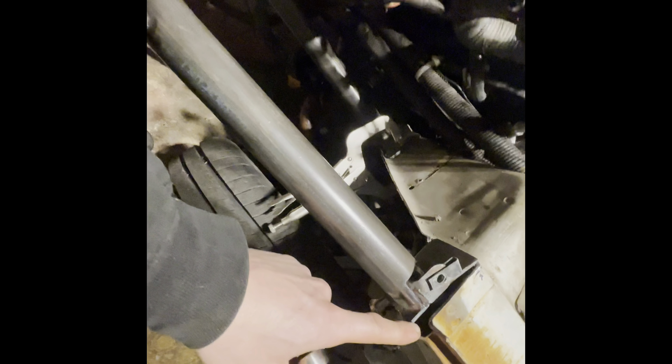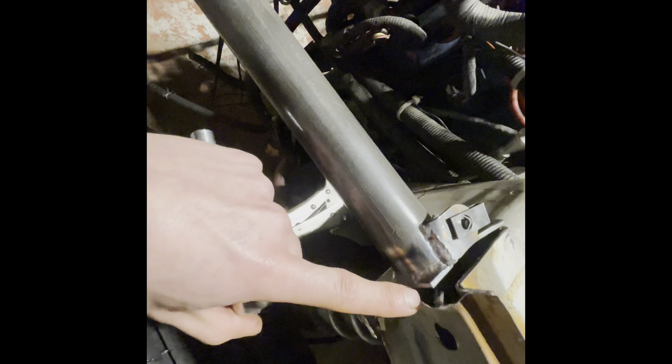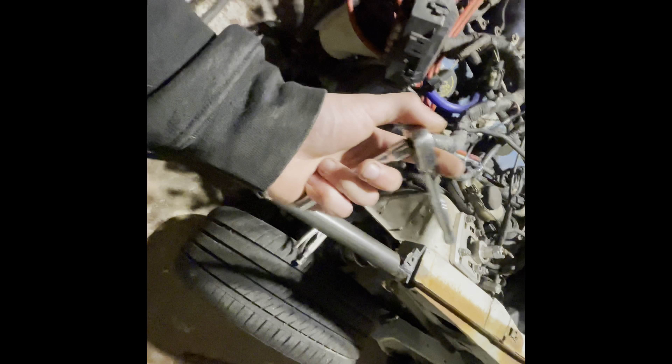But if we come over to this side, this is where stuff gets a little bit hairy. As you can see, we have a pretty significant gap right here — it is pretty bad. Remember, this is the crash side, so this is all tweaked and everything. What I'm going to do when I go to fit this back up is tap this in, tap that down, tap this back — whatever I've got to do to close this gap the best that I can — and then we'll weld it in. Same thing down here; this actually fits pretty well. I did have to pull it down slightly because it was up, so I pressed it down and put my clamp on. With any aftermarket part you're going to have to make it work, and on this particular car it was wrecked, so we have a little bit more work to do than if we were doing this on a clean car. But it's nothing crazy.